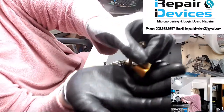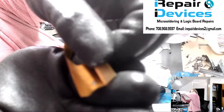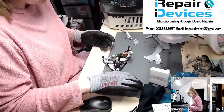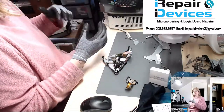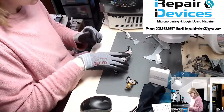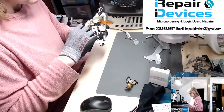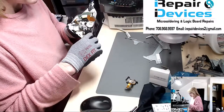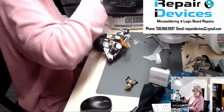depending on the ribbon cable layout, there is this little dot of solder, and it's to protect the laser from static and everything. So before you install it, you have to remove that solder blob. And so right now I have it installed, so now let's get this guy powered up and see if this works. And just to recap, the initial problem was, do I have it here?